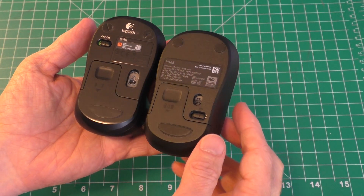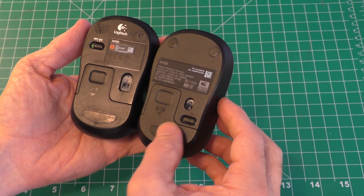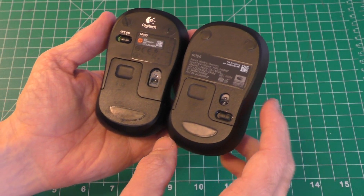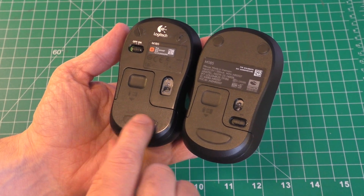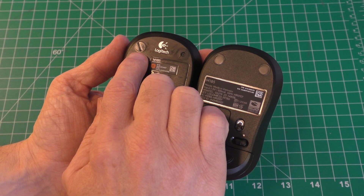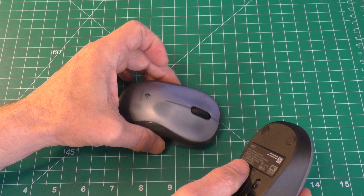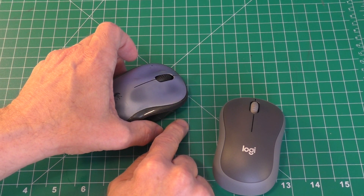What I think is the problem are these little mouse feet, or sometimes you call them pads — but actually they're called skates because they're a Teflon-coated little pad. In this case we have three: one big one here and two small ones up on top. The big one is still pretty well intact, but the Teflon coating is probably worn down so it doesn't move as smoothly. The top pads are completely gone and they've fallen off. The lack of these pads reduces the height when you're sliding the mouse around, which could potentially cause tracking issues — it's a little too close to the surface.